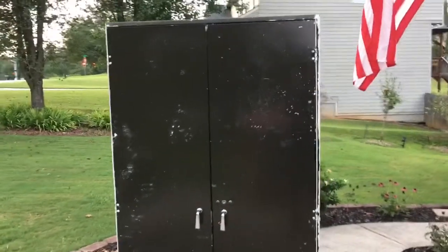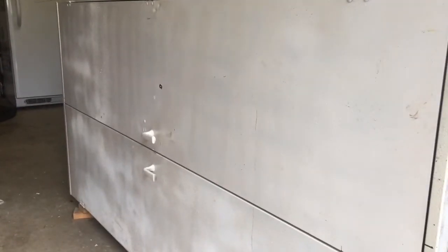There's content showing metal cabinet restoration with complete paint removal to bare metal and removing spray paint from vehicles, but this is not car paint. It's an industrial metal cabinet predating World War II, and I want to honor that. Grinding it down to bare metal and repainting it is going to be time consuming and messy. Plus, this original paint may contain lead, and I really don't have a proper painting setup anyway.